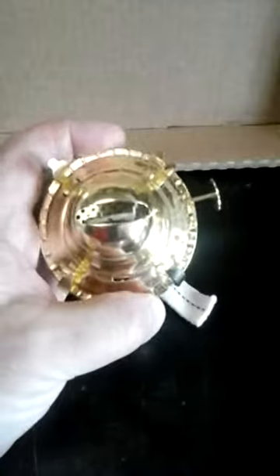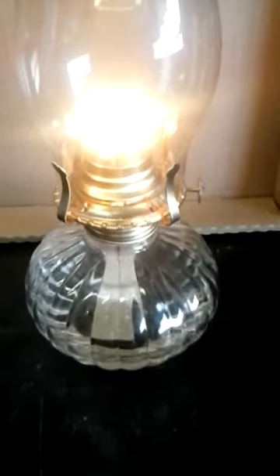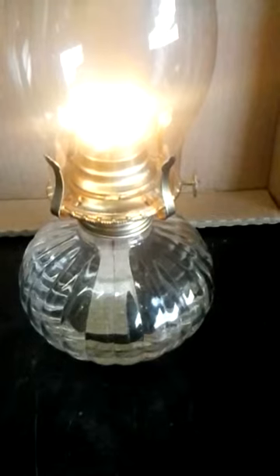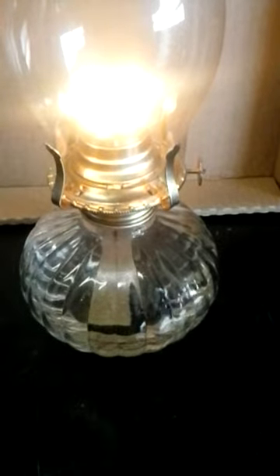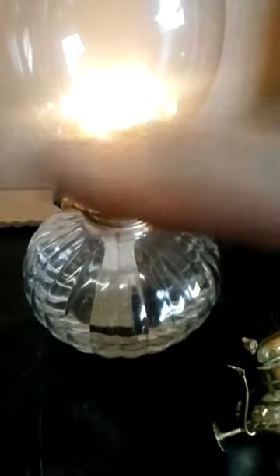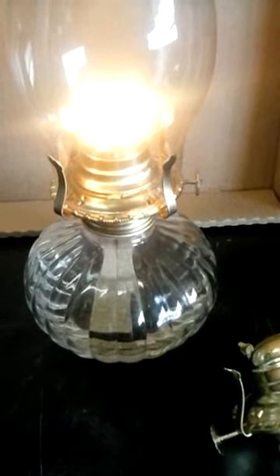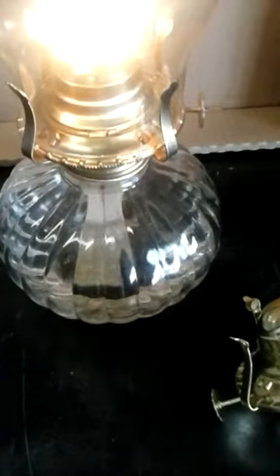I just picked up the spare burner for two bucks so I could show you. That's about it for the video. These are excellent to have around the house for $7 — great if the power goes out, some nice mood lighting, way better than candles or anything else. I still highly recommend them for less than seven bucks. You can put some kerosene or lamp oil in it and try it. If you think it's using a lot of oil, if you get a smell, or if you're not happy with the flame — this one used to have a rounded flame and was quite sooty and smelly. Since I squashed the wick guide and took out that play, it started burning a lot better. Thanks very much for watching.